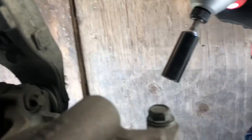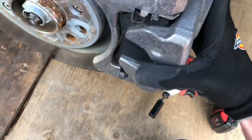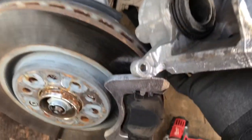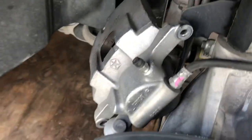There's another one down there on the bottom, and you just pop those two bolts out. Set them aside and now your caliper is free, so you're just going to want to take it, pull it off, and find somewhere to rest it — probably just prop it up on the steering components back there. That way you're not putting pressure on your brake line, less chance of damaging it.